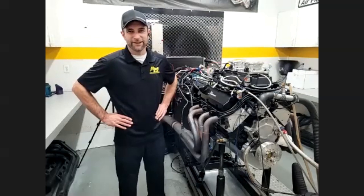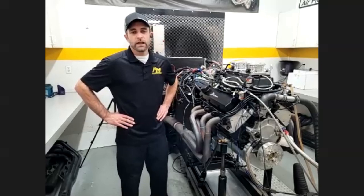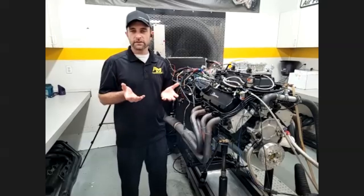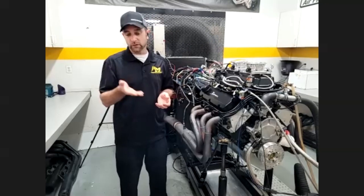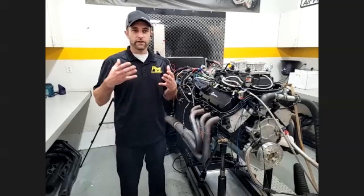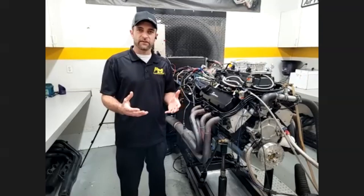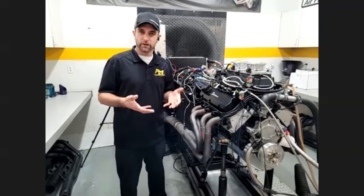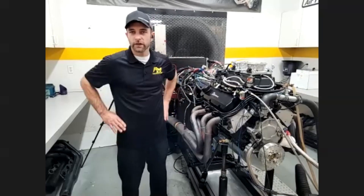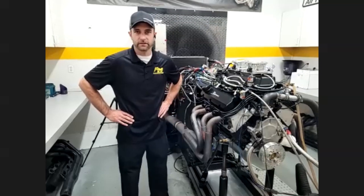Lean is mean. But that being said, when it's too rich on nitrous, what can happen is if you get a certain amount of nitrous caught between the rings — between the top and first and second ring — and there's some fuel in there, if it ignites in there you could have a situation where that fuel got in between the rings with a little bit of nitrous and boom. If it ignites in there, that's how you lift the ring lands off the piston. So rich isn't always necessarily the safest thing.